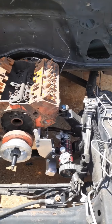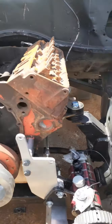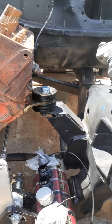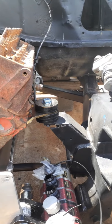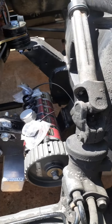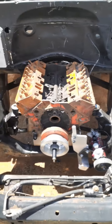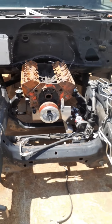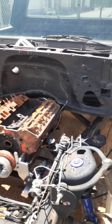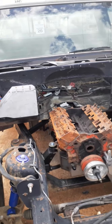For now it's where it's at. I might even go as far as raising the engine up a quarter inch — I'll make a little spacer plate to go between the motor mount and the frame mounts on both sides, raise it up a little bit for more space. I don't like the idea of that touching because the engine is on rubber bushings and I don't want that interfering with anything.